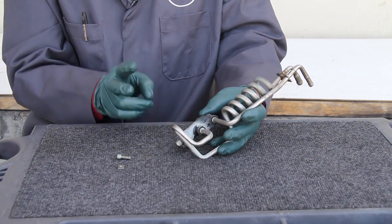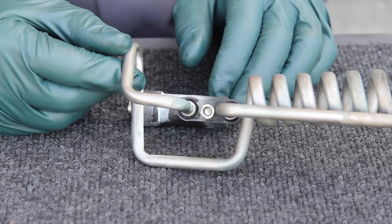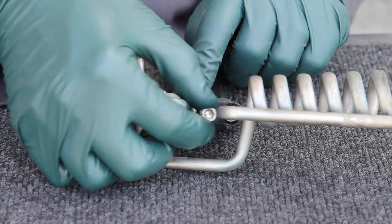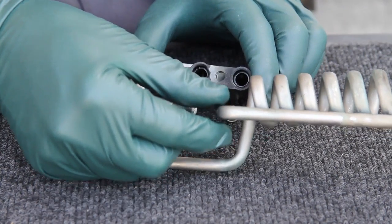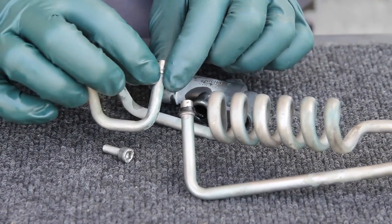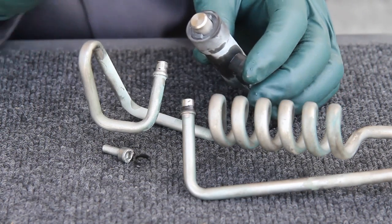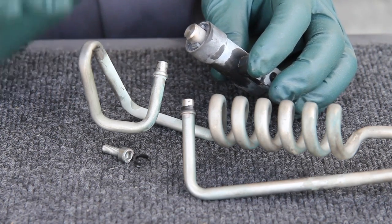The problem is twofold and I'm going to zoom in here and show you this in more detail. Coolant leaks can occur right here where the coil goes into the plastic housing at either of these two locations. Removing this bolt will allow you to pull the thermostat housing away from the coil ends, and if you look closely here you'll see there's a couple of O-rings. This one — the O-ring seal has been damaged.